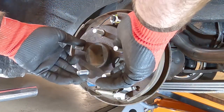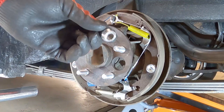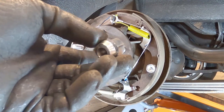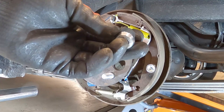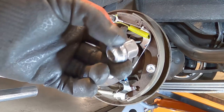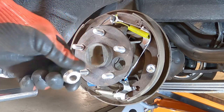That's it, it's pretty simple. It doesn't take much to install these studs — just punch them out from the front, put them in from the back. This lug nut is now sacrificial. If you had an actual nut, these are one-half by 20 thread pitch, that would probably work just fine. I just used an old lug nut I didn't need anymore, cut the back off in case the bolt needed to come through. But we got all these installed. Now we can go ahead and put the drum back on, put the wheel on, and I'm set.